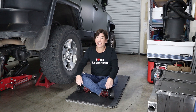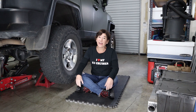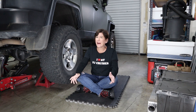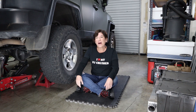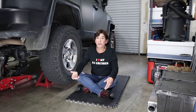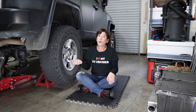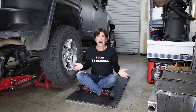Today we're working on one of my favorite daily drivers. She's a 2008 Toyota FJ Cruiser that I bought in 2010 with about 44,000 miles on her. Anybody with a Toyota can tell you that's still fairly brand new. She's now got about 120,000 miles on her, which means she's also got a blown axle seal. This is fairly typical with high mileage Toyota trucks — Tundras, Tacomas, and FJs. Nothing to worry about. Today we're going to pull the axle, and as soon as I gather all my tools together, we'll let you know how that's done.